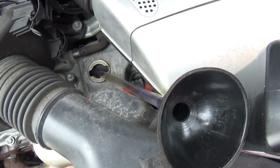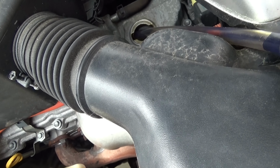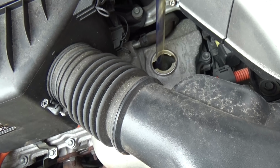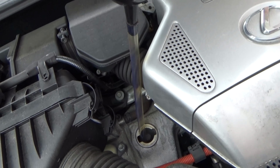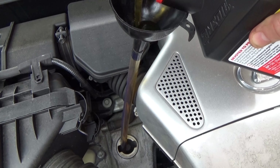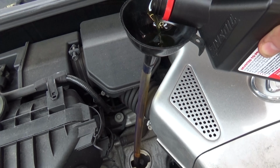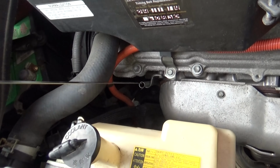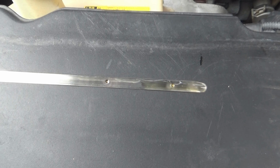So look up the specs for your specific make and model to see how much oil you should add. You know, most vehicles typically hold around 5 quarts, and an oil change doesn't get all of the oil out of the system, so it's hard to say, but just look yours up online. And if yours says that it takes 5 quarts for a complete refill, I always like to start by putting 4 quarts in, do 1 quart less, and then pull the dipstick out and check it until it gets halfway between these 2 dots. And if you have trouble reading an oil dipstick, I have another video I'll link below on how to do that.